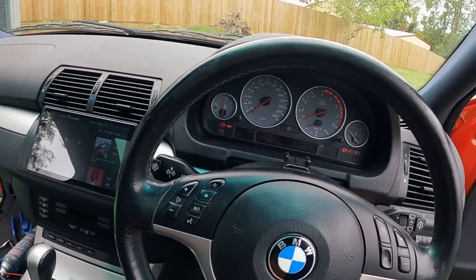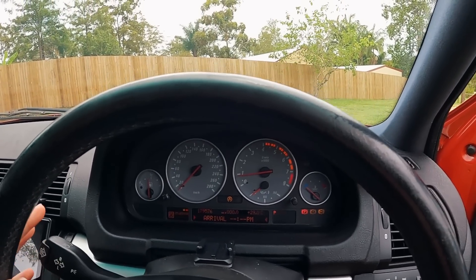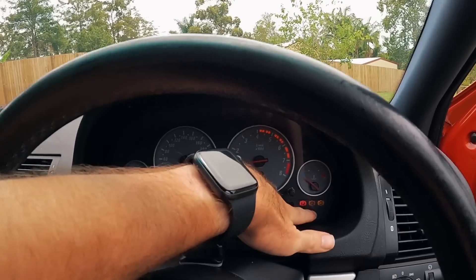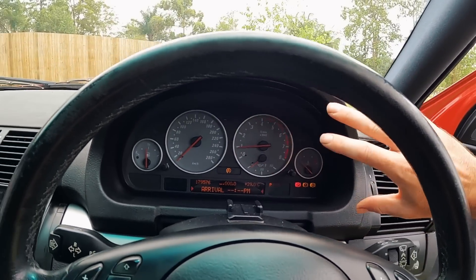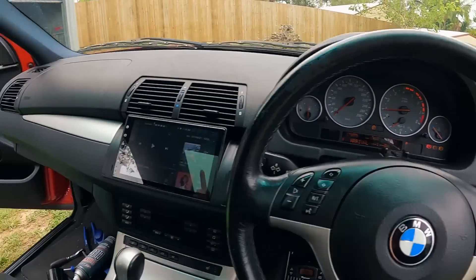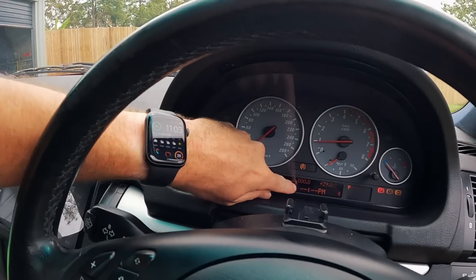I can't do much about it for now. Aside from the brake light warning, we have indicators and all that. These light warnings are coming up because I had the battery disconnected — I was trying module resets. That should all go off once it starts rolling and the speed sensors are registered with the ABS module. I do need to get the light control module from the E39 coded for an E53 and the mileage updated so we can get rid of that tamper dot — I don't want it to look like we've been messing with the kilometres.